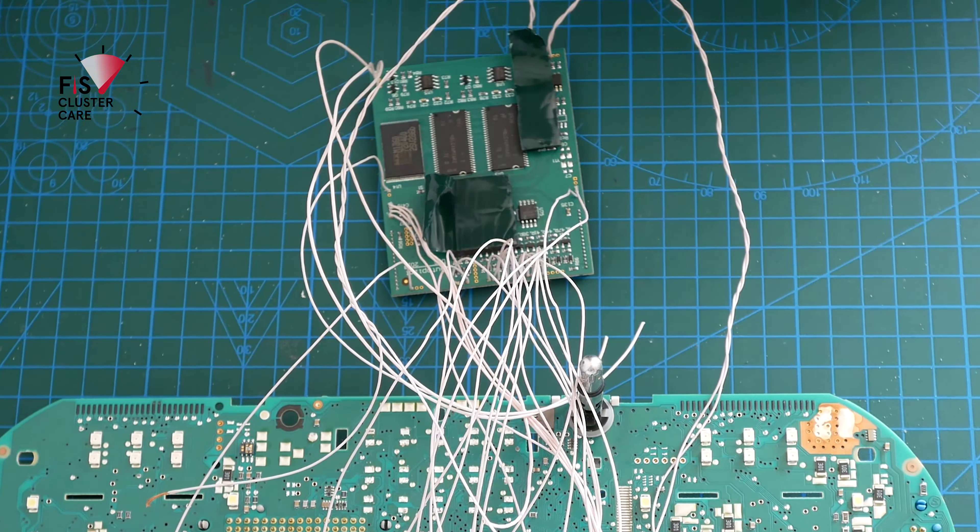Next is sorting out your wiring — figuring out which wires go into which areas of the board. You can follow the wiring diagrams from the ColorMFA.ru website to determine which wires belong to the green plug, which to the grey plug, and which to the blue plug. The Audi TT cluster is a special case where you have to solder quite a few wires into the grey plug first, because once you've stuck that board down a few of the pins from the grey plug become inaccessible. So cut and prep all the wires needed for the grey plug before sticking down the ColorMFA board.